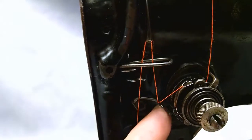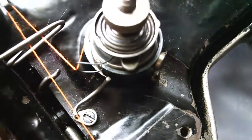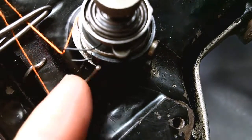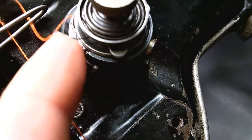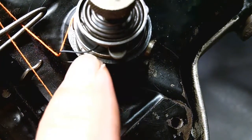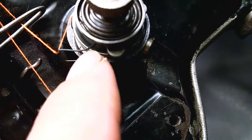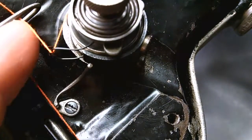And then we've got this bobber. It's a black bobber. See if I can get a better picture of it here. There we go. See this spring here? If you're missing that spring, it's not gonna sew with a hoot. A lot of these older ones are missing the spring. Not hard to replace. They're fairly inexpensive, and you've got a little plate here that has to be adjusted right so that spring is basically 90 degrees out, straight level out from the side of the tensioner, and it's just got a little bit of spring on it. It's got to return.